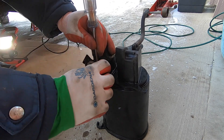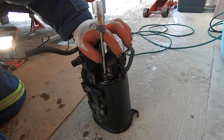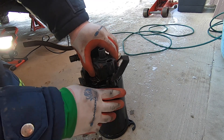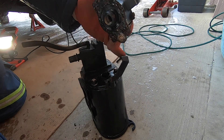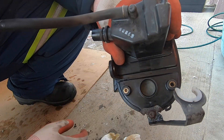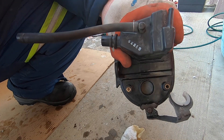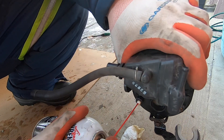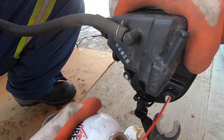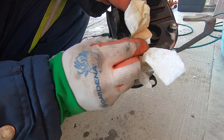There we go — magic. To take it off you just wobble the solenoid off like so. Once the solenoid has been removed you can see it's just a little felt pad covering the charcoal media inside. Before reinstalling the new solenoid, take penetrating lube and flush out those screw threads to make sure there's no rust debris inside.